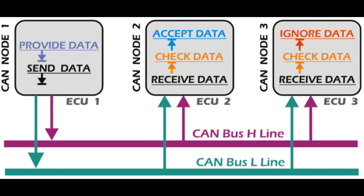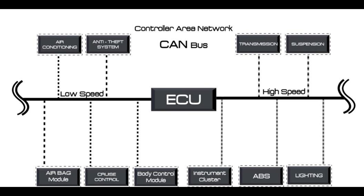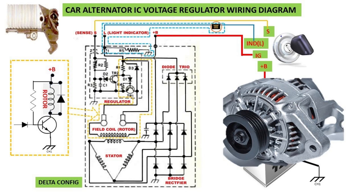That's called a CAN bus — Controller Area Network. It sends a digital signal from one control module to the next. For example: the engine controller tells the instrument cluster how fast the engine is spinning for the RPM gauge, how fast the vehicle is moving for the speedometer, and all the ancillary gauges — engine coolant temperature, voltage, fuel level. All this information flies around in digital packets with identifiers tagged on so whichever module knows what it's listening for can take that data and decode it.